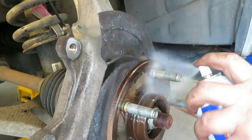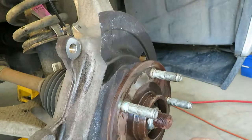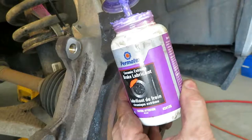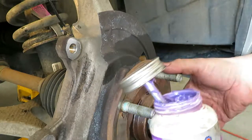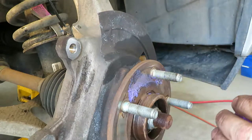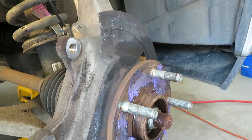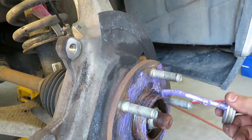I'm going to take some brake cleaner and just spray the hub to get any little grease off, then wipe that hub off nice and clean — this one wasn't too badly corroded. Then once it dries, the next thing I like to do is put some brake lubricant on it. This is called Ceramic Extreme by Permatex — it's a high heat lubricant, and it'll help the next person who comes along to take the rotor off. It won't be quite as stuck to the hub. I like to put a fair amount on there. This is a high-heat product so it won't melt and get all over your brakes.